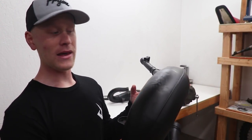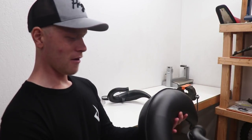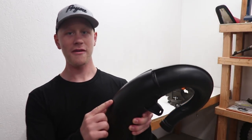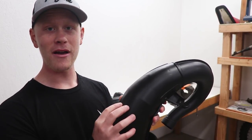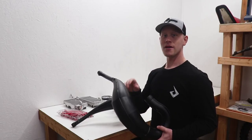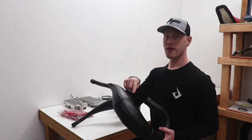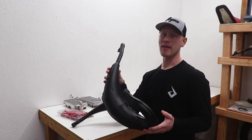For some reason they decided to spray paint the pipes — on the 125 pipe there are drips in the paint, which I'm not happy about. I had this pipe raw steel from the beginning and I don't know why they spray painted it, so now I have to strip this paint off and recolor the welds. What I'm going to do is strip the paint, color the welds with the torch, and then see if I can burn off some of the carbon buildup inside the pipe as well.